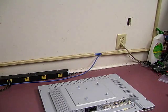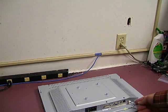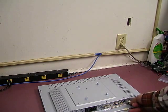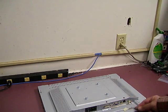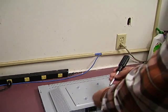Now we have to remove the RF shield before we can get to the electronics board. The first thing you'll need to do is remove and unplug this little cable. It does have a small clamp on the end so you need to squeeze it before you remove it. Then we'll remove these screws — there are two black screws here.